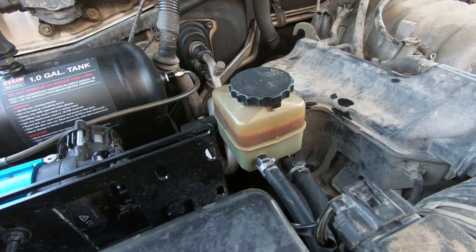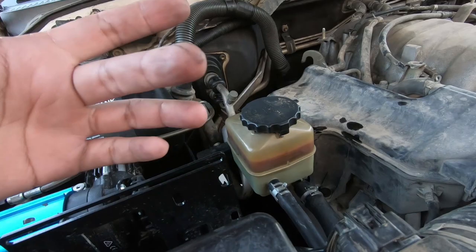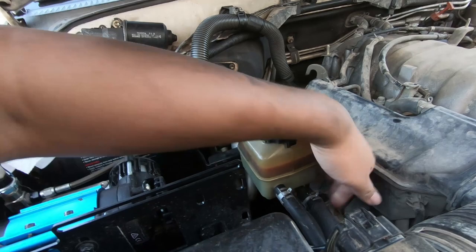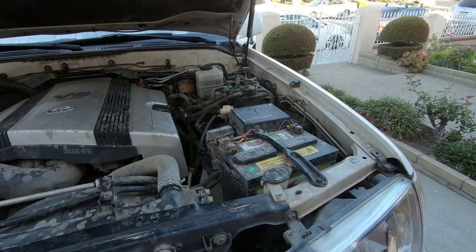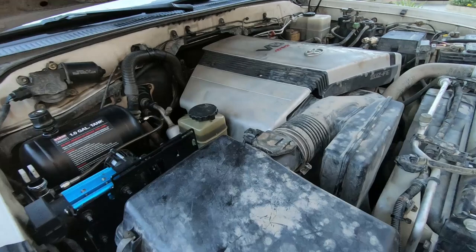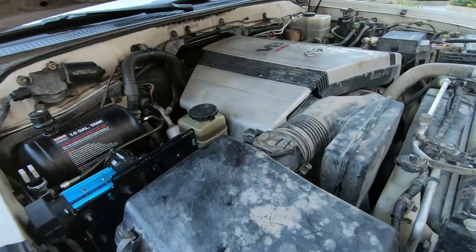The last thing you want to do is check for leaks — touch the bottom and see if there's any transmission fluid. There might be some residue from before, so make sure you clean it off, drive it around, and check for any leaking fluids. The level went back to almost normal, so I'm just going to run the car like this. If you listen, I don't think you can hear that whirring noise anymore — it used to be a lot louder. That's how you change a power steering pump. In my case, I don't think it solved the issue entirely — the power steering did get a lot better and is more consistent — however, the annoying whine is still there. If you have a clue what it is, please comment down below. If you're looking for more Land Cruiser videos, check out my channel, and as always don't forget to like and subscribe.